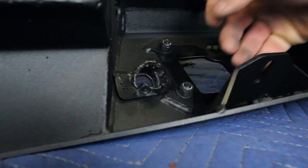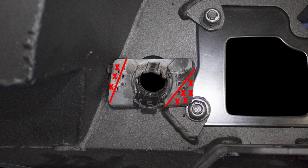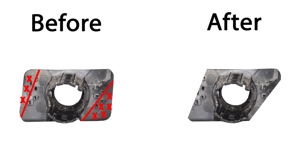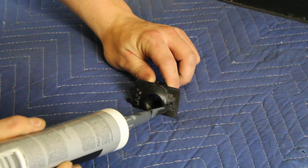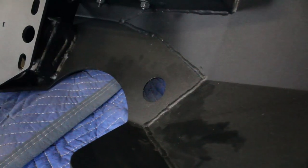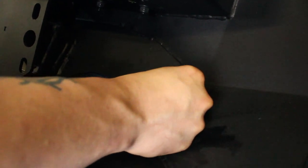Hold the two innermost sensor rings in place on the bumper, putting them into their pre-cut holes from the back side, then mark the ring mounting plates. You will have to cut off any material that interferes with the bumper panels and welds. This picture displayed right now shows where to cut your mounting plates — everything with a red X will need to be cut off. Install the parking sensor mounting rings onto your new bumper by applying epoxy or something similar to the front face of the mounting plate, then hold them in place until the adhesive sets. Make sure to install these in the same position and orientation as they came off your OEM bumper.